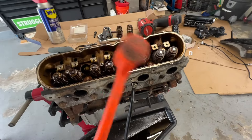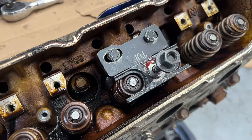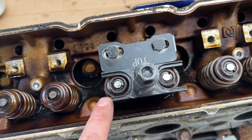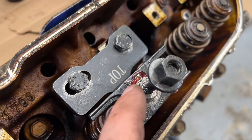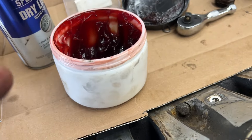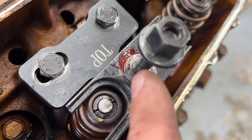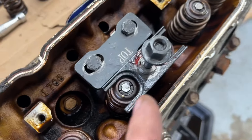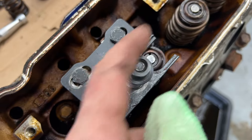And that's plenty to knock the crust loose where you need. Another tech tip: this is like an $80 Amazon spring compressor and it works amazing. The biggest thing about making them survive is I put a couple washers and I put axle grease — cheapest stuff, like Wolf's Head or something — on the threads. If you use an impact gun it lasts way longer. But if it's your first time doing this, you should probably just crank them in slow by hand so nothing wild happens.